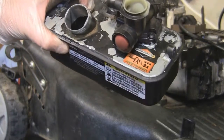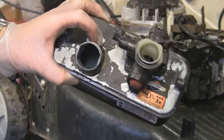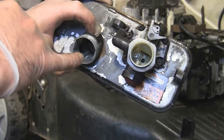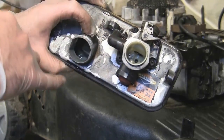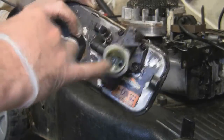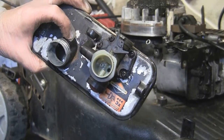With the petrol tank drained off, as you can see there's nothing in it - we got rid of all the petrol and oil in the garden. Take a good look inside - you're particularly looking in here. Make sure there's no rust. As you can see, this is nice and clean at the bottom. If you see any rust or anything floating about in it, you're going to have problems when it picks it up through the carburetor. Make sure there's no rust in the bottom, nothing floating about, and particularly no water. Make sure all these parts are clean before you take this off.